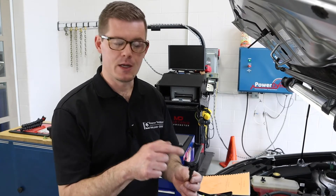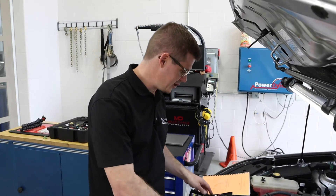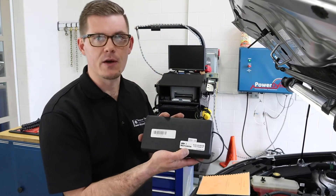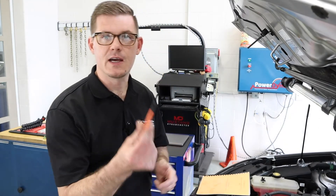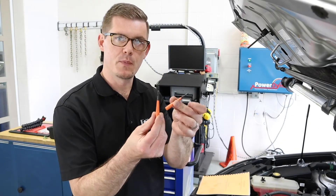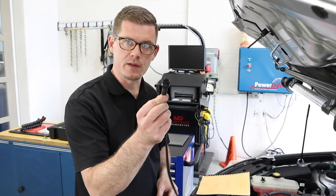The next thing I need to do is connect this connector to my fuel injectors — one at a time. I unplug one and figure out how to get my two leads connected to that injector. There are some special adapter harnesses available; you can even get small pigtails from injectors at the junkyard and make them into test leads. I don't have one for this specific Toyota, so we're going to use this Rotunda flex probe kit. I've identified the specific size that fits on my injector and I'll insert both probes, add test leads, and get them out to male terminals to plug into the box.